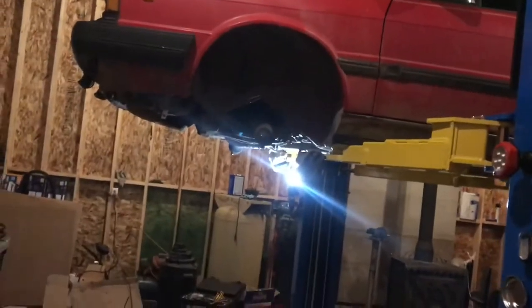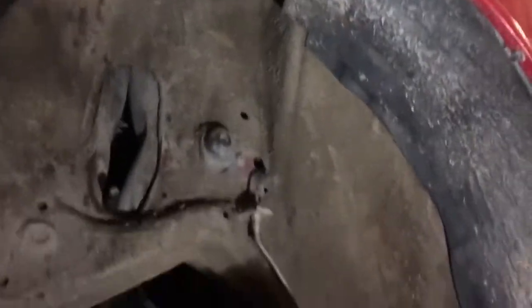We're in the shop and the Audi is coming apart. You can see the front end is all off. We wanted to do the front end first and then tackle the back end — that way we see the problems and tackle them as they come, hopefully making the back end go easier. We got the whole hub and everything out. You can see the hubs sitting over there — one there and one right here. Unfortunately this one has a bad wheel bearing; it's got some wiggle in the hub.